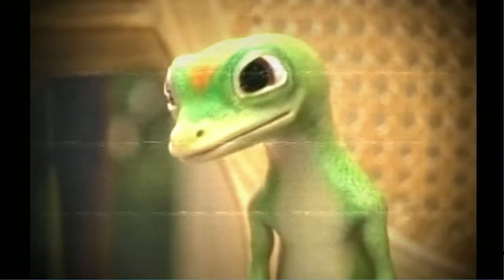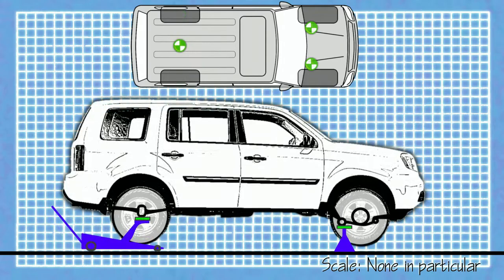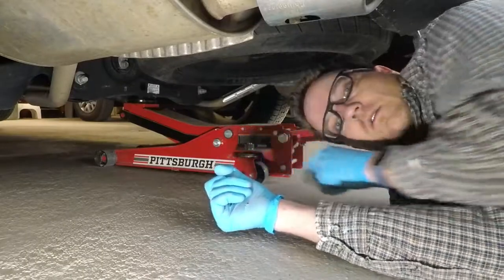As long as you're working on a hard floor, this setup has a low risk of failing. Where you will get into trouble is if you proceed to lift the vehicle from the rear without remembering to pull that front jack out — and you won't realize what you're doing until the vehicle starts to rock precariously on its center axis. Lower and pull that front jack out, then lift the rear. We're now back to a triangle support, and unless you have another pair of jack stands to secure the rear end, this is not a solution for working under the vehicle, but for quick wheel swaps or rotations it will normally hold.